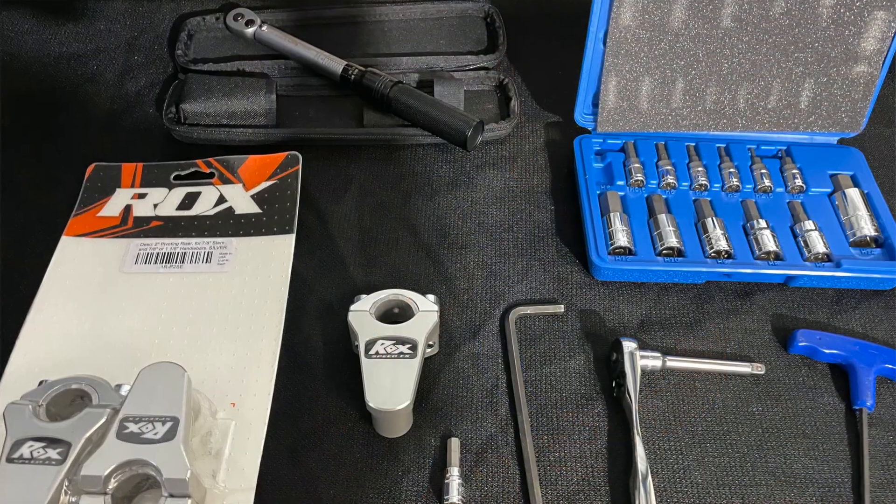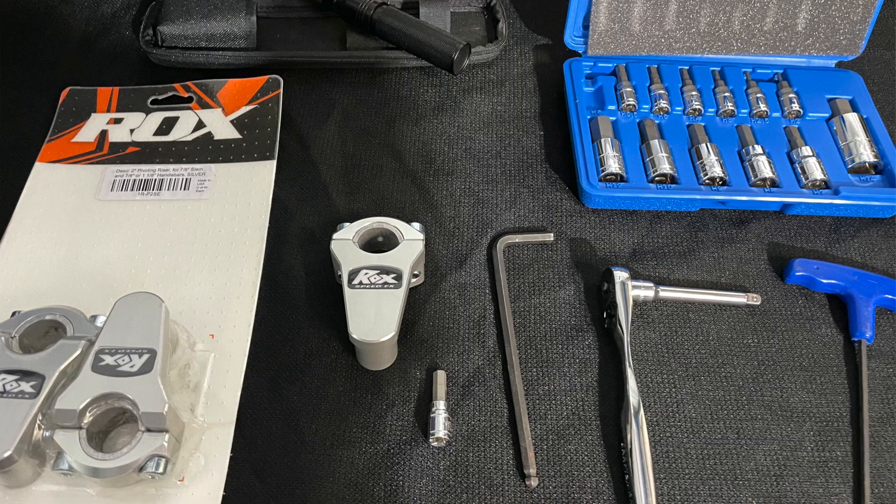It's fairly simple, but you've got to make sure that you get everything in the right order, so you don't have any kind of problem with controls — whether they get bound up or access to these bolts down here can be a little bit challenging. All you're going to need for this install on this particular bike is a six-millimeter Allen wrench. I have it in both socket form and a ball-end wrench, which makes it a little bit easier because of some of the ways you've got to get into these particular nuts. It's not necessarily an easy install, but it's a pretty basic install. We'll get started by first taking off this top triple clamp.